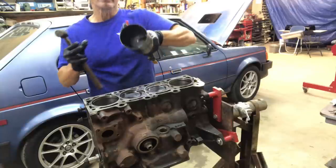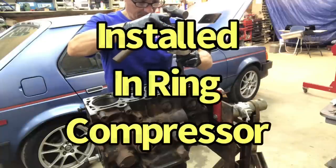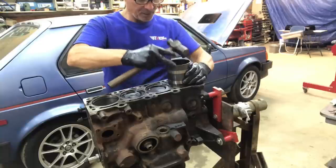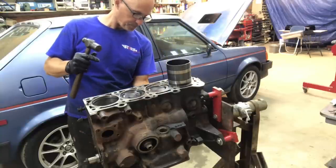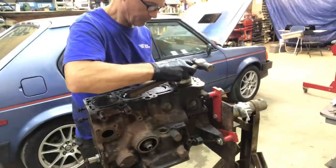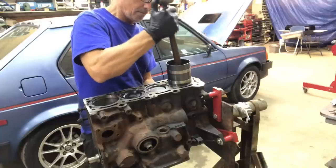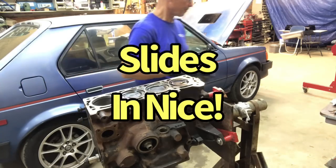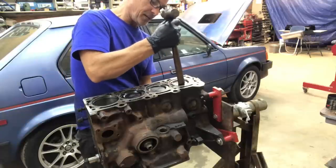It's going to orient it right — it's got valve relief and also has an arrow to tell you where the front is. So I could slide this in; we've made sure to put lubrication on the walls and on the piston, and on our tool. We've oriented the rings properly. Got this thing lined up — boom. In this case the crank is down, my finger's down here, you know, your guides are on it.